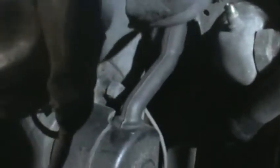And then back underneath where the blower motor is, there's two wires. That one that you can see right there is I believe a ground, and then further down underneath, if I can get an angle on it, you can see the wire going to the plug right there. I'm going to pull those off. I don't think I can hold the camera and focus on it and show you me pulling those off, but I'll set the camera up on the other side, focus in on the box here and go to work on it.